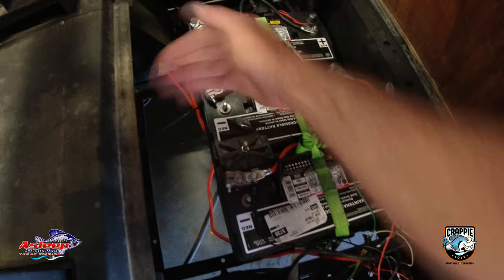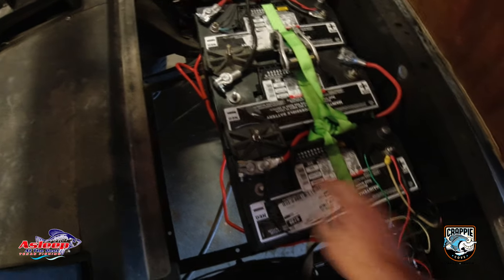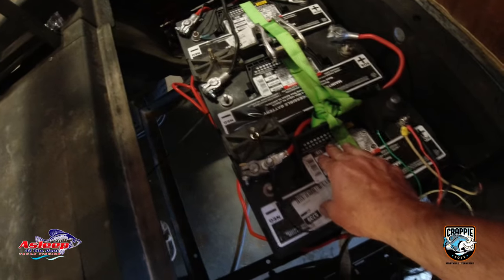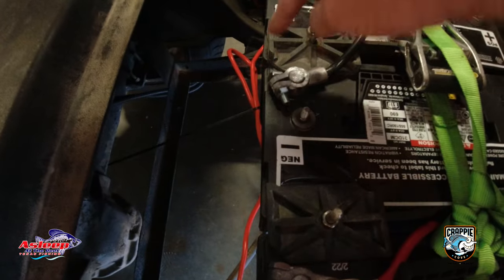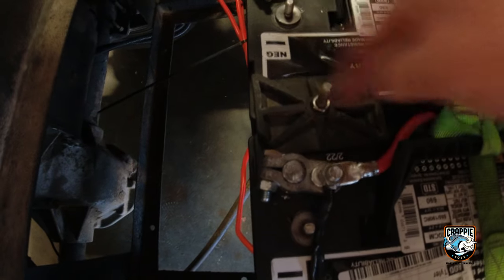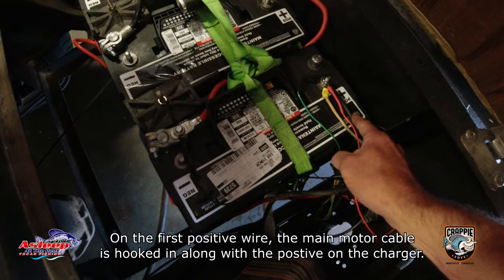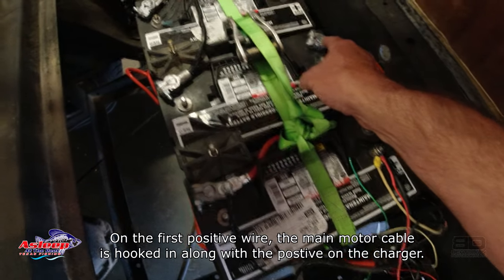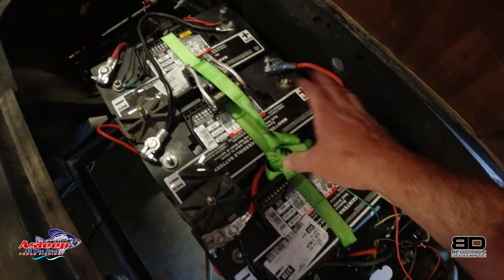Because everything is set in here, there is a spot made exactly for those original batteries, but I had to do a little reconfiguring. It's sitting on the initial rail down here and on top of a rail, so I just put this tie-down strap on there to keep it together. These right here were one piece that went right in between and kept all the batteries down. What I did was I dremeled it out — cut the piece here and here to fit right in. These tie-downs keep the batteries down that way, and then the strap keeps them this way. I don't have the right color leads on the wiring — that's my fault — but I know what it is, so I'm not worried about it too much.